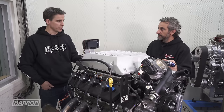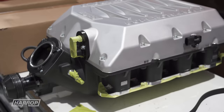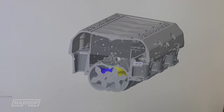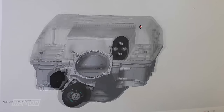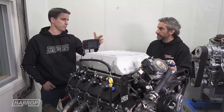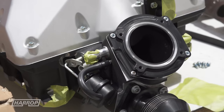When the engine was released, we were quick to get one to develop the supercharger. This is a pre-production unit, so it's inverted. It's using our TVS 2650 air pump. It's got a really big brick inside this billet top lid, large inlets and outlets on the intercooler to get plenty of coolant flow. And we can run a bigger throttle body as well, which for max-effort combinations further down the development path we'll definitely need.